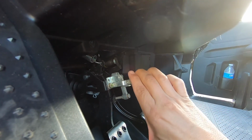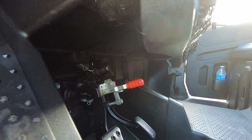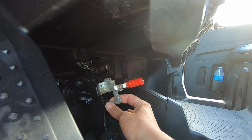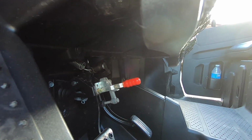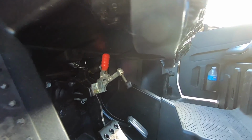The problem I'm having with this is it's not lockable. The other issue is you can forget to take this off, and the Honda does have enough power or torque to drive over it. This stud I've replaced once already. I wear these rubber pieces out on the bottom, but I mean, look at how much more. It really needs another half an inch. And then if I could have this lock somehow, that would be even better. Don't worry, I've got a fix for that. In my next video, I'm gonna remove this barbecue lever as my parking brake and replace it with something else that locks. So make sure you come back and stay tuned for that.